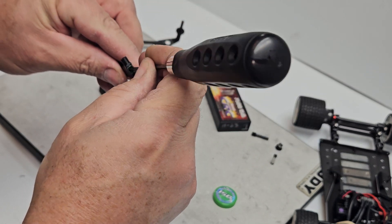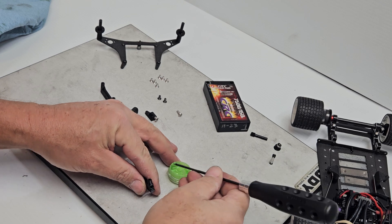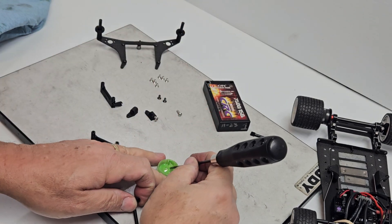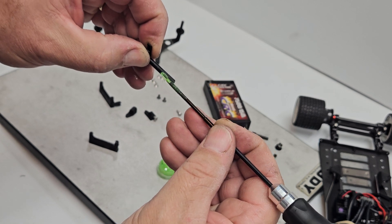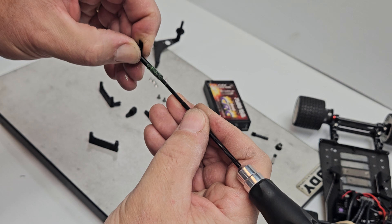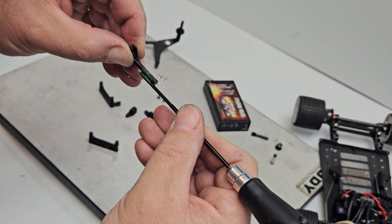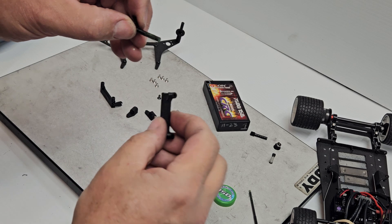...stick a dab of grease down in there, rotate the wrench around to smear the grease. I'll put about three dabs of grease in there. Then take the rod, get a little grease on it, coat the end — kind of like buttering it — nice and smooth all the way around. You don't want it too thick because it'll just push off when you insert the rod. I do about half to two-thirds of the rod, and you can adjust that based on how much damping you want.